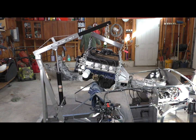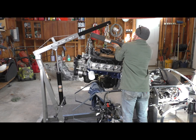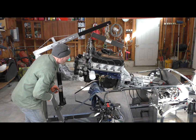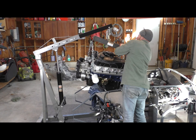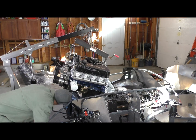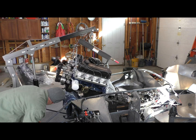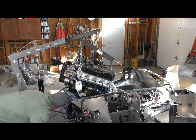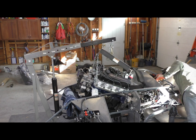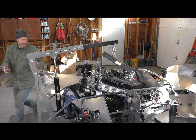You'll notice that a few times while I'm doing the motor installation, I go and grab for some bungee cords and things like tie-down straps. I use these as that extra set of hands. The bungee cord actually was a really good find. That allowed me to put the transmission portion under just a little tension to the left. The motor kind of wanted to swing to the right, and the bungee allowed just enough tension to pull it to the left, and at the same time allowed me to continue on in and down with the motor.